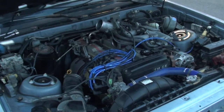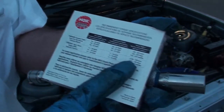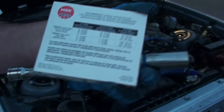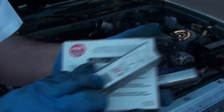When you're getting ready to put your new spark plugs in, they'll have torque measurements. And if you don't have a torque wrench, then they'll say how much to do it by hand — quarter turn, half turn, two-thirds turn. Just go by what's on the box or the back of the spark plug, and you should be good.